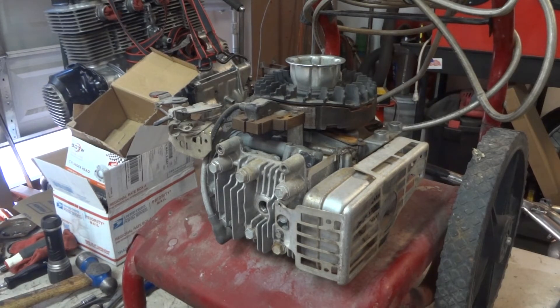Even with an ultrasonic cleaner, you can clean and blow it out as much as you want and may never get what's stuck inside out of there. There was actually quite a bit of debris in the bowl. There's no fuel filter on this thing currently, but there will be one when we put it back together. It could have been dirt that got in and clogged it up. Anyway, I'll bring it back once I get the carburetor and everything back together and we'll fire it up and see if it'll run without choke.